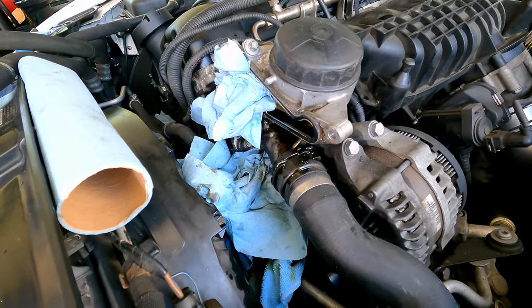Make sure you're using non-chlorinated brake cleaner. What I'm doing is getting the gunk off, because ultimately when I do take off the oil filter housing gasket, I don't want all that dirt to be trapped and go right into the oil. Look at all that — that is some nasty, nasty stuff.